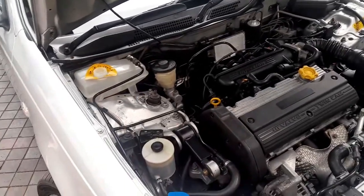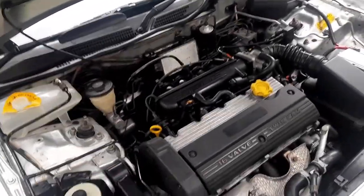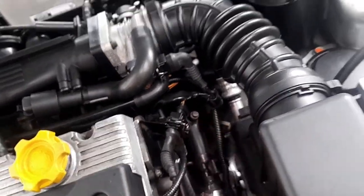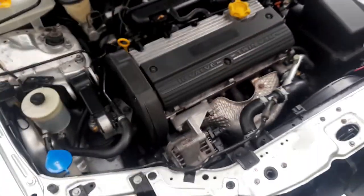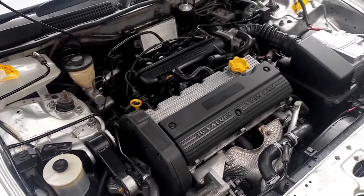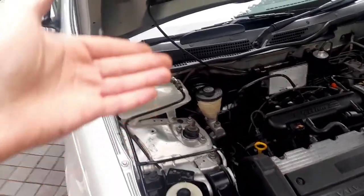I've never used my kit and I don't need to. The Focus Mk1 bleeds itself really nicely. And Rover 45s, you do have to do it a bit more thoroughly, but the way I did it before was by releasing trapped air every so often, and I didn't have an issue. I've never had air bubble issues with this car the first time I did it, because I did it properly. But I would recommend that you fill it gently.